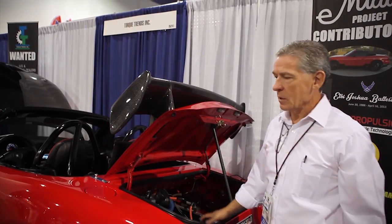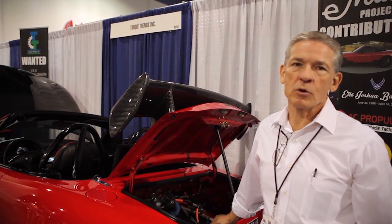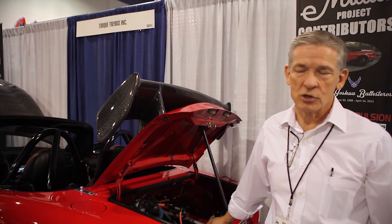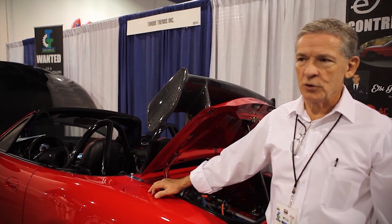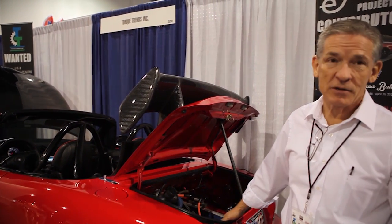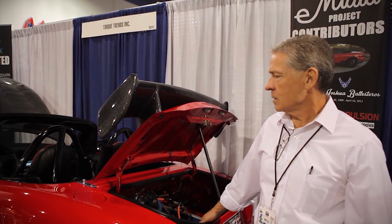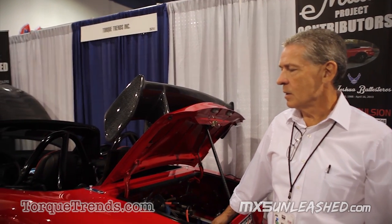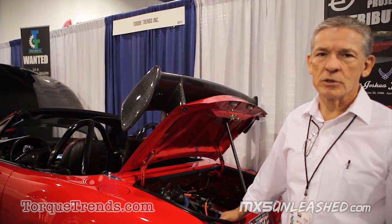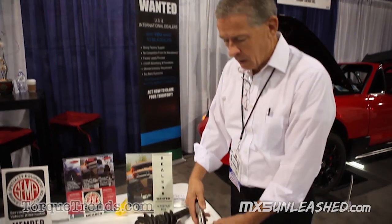This particular battery pack gives us 22 kilowatt hours of storage, which driving normally gives us about 115 miles of range. The Level 2 charge port is under what used to be the gas cap — we call it the juice cap. With 240-volt, 30-amp charging, we charge in just over two hours, a little longer on solar. We usually charge the car at home with solar energy.